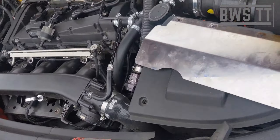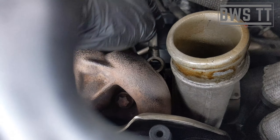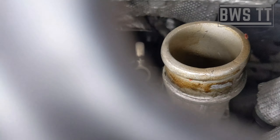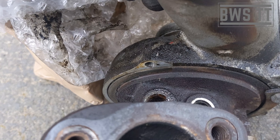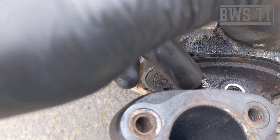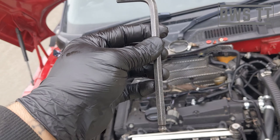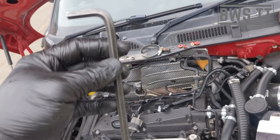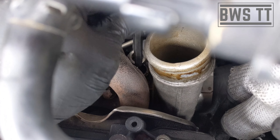The issue is that you have to take off the coolant banjo bolt and take the coolant line out of the way, because as you can probably tell from that image, when the 10mm bolt comes out, it blocks access. I've had to use an 8mm Allen key, and you can see from this angle it just gets in at sort of that angle there.